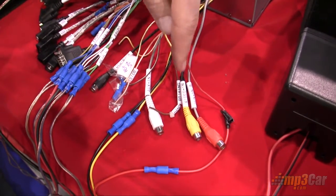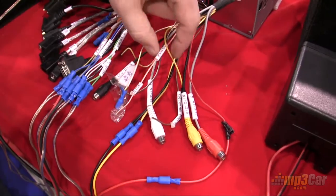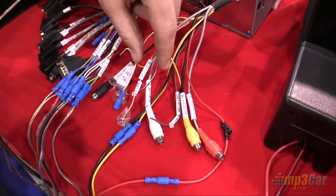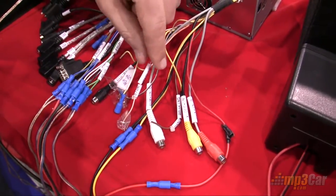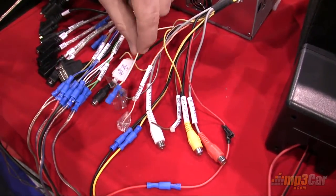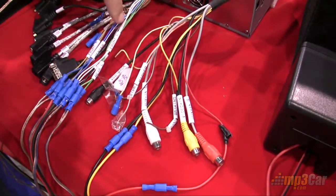This video-in you could use for things like an infrared night-vision camera on the front of your car. We've got a handbrake sensor, which is required by law in the United States. They've labeled this side marker — what side marker means is when you turn on your headlights, it dims other accessories in your car, so this is a communication to allow that. This is the accessory wire, and this is the backup camera I just mentioned.